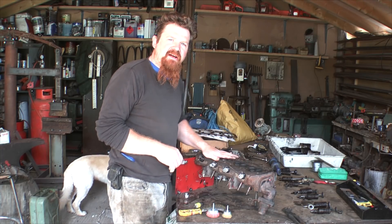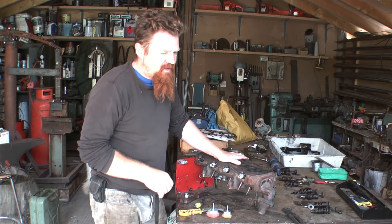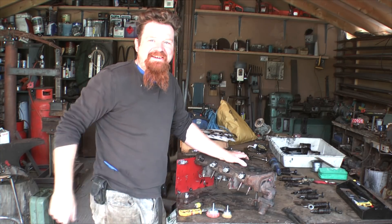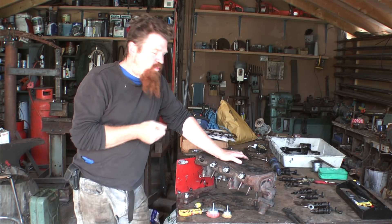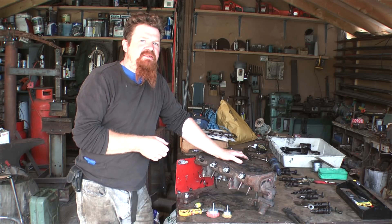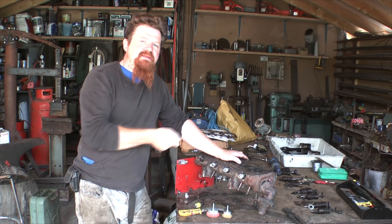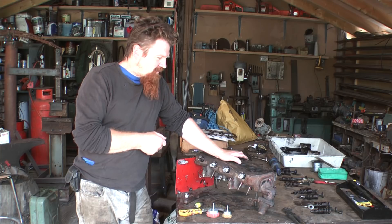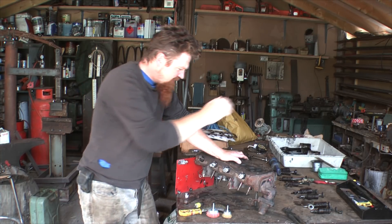This is made of cast iron, which makes cleaning up a lot easier really. The last one I worked on was made of aluminium and it was quite nerve-racking. I ended up soda blasting it, which worked brilliantly. I went to a supermarket, bought their entire stock of baking soda and used it in a paraffin gun as a tiny sandblaster — worked a treat. The best thing is the residue, you can just rinse it away. Anyway, back to the tractor.